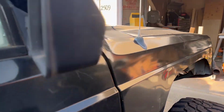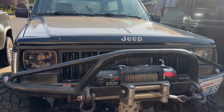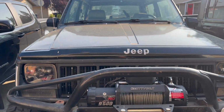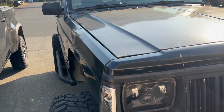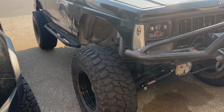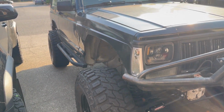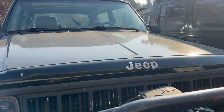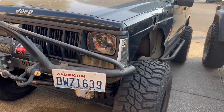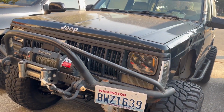First things first is this Jeep doesn't even start, so that's where we're going to start. My guess is that the battery, even though it's newer, I think there's probably a draw somewhere in the Jeep that kind of caused it to just go bad after sucking it down so many times, time after time after time. Eventually the battery will fail, and so that's my first guess, that it has a parasite, so hopefully I can find that, put a new battery in it.